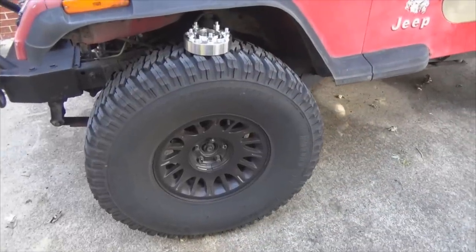And trust me, if you're trying to let out the clutch when those lugs are biting into the spring, you'll stall the motor out before the second roll out. So that's where the wheel spacers come in handy, to push the tire outward to give you clearance on your springs. Well, let's do the driver's side front first.